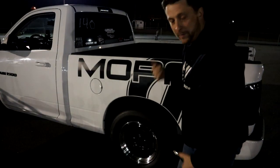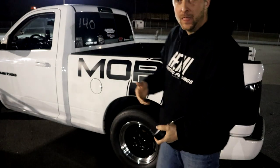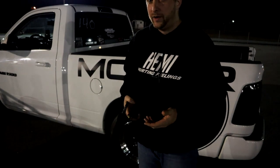We got teched in, we're about to adjust the air pressure. We're gonna start out at about 20 PSI. Usually I do pretty good at around 18 to 20 PSI on the Mickey Thompson ET Street R's. So like I said, we're gonna try them at 20 and go from there.